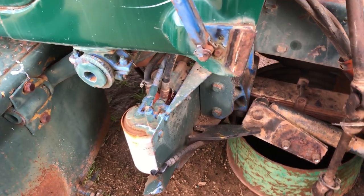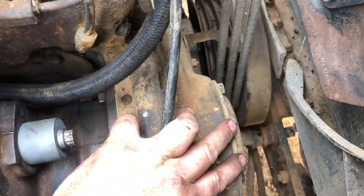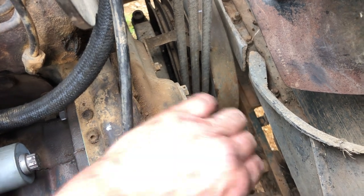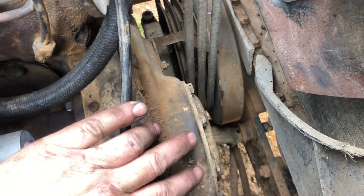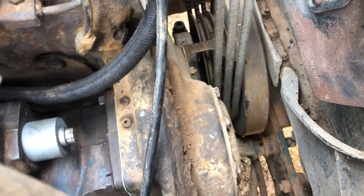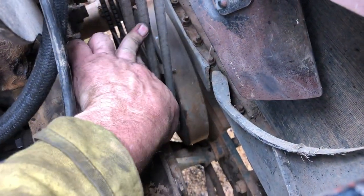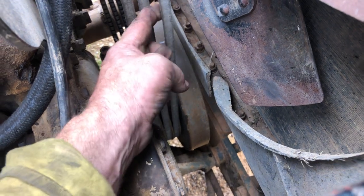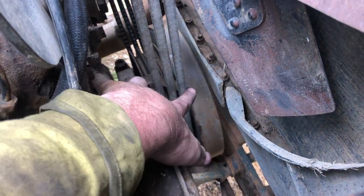When the video starts, I'll probably begin at the spill timing. I did do a spill timing video on the B model but it wasn't all that comprehensive. There's a cover at the front — it's got eight bolts I think — and it just exposes the drive coupling at the front of the fuel pump. That's where you can adjust it. If you look at that harmonic through the belts, you can see a white texta mark I've drawn on the harmonic there.